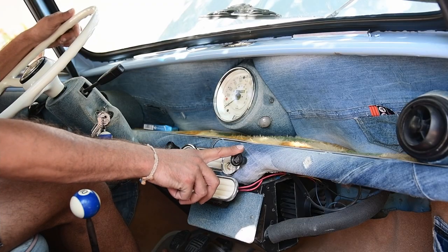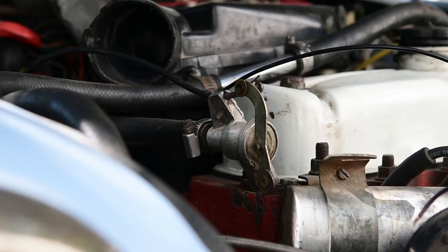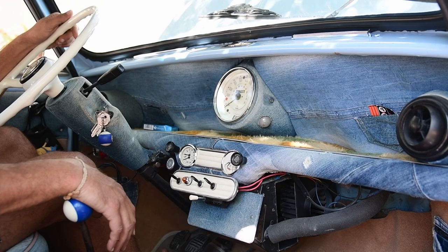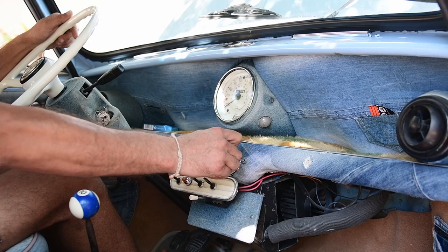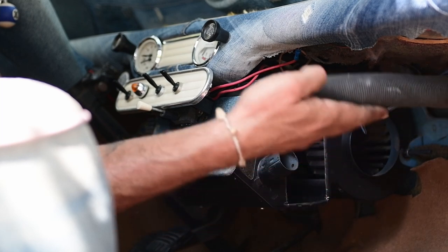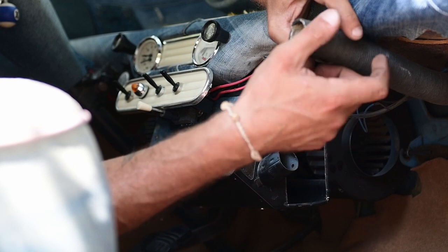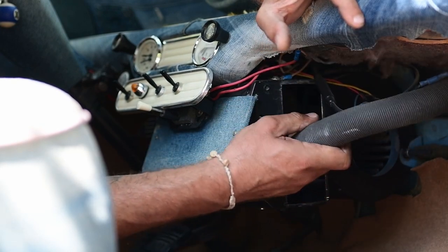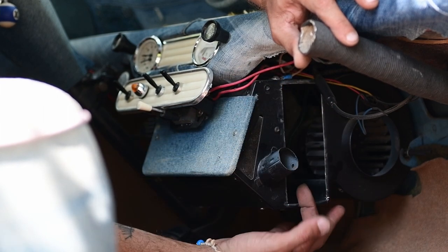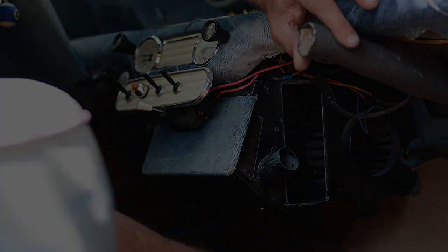By hooking the system up to the on-off switch for the heater, I can actually control how much cooling I get, when and how. When things get hot, I switch the system on. When things cool down again, I switch it off. The auxiliary radiator is actually the heating element from my cabin heater. I modified the box so I can slide the auxiliary radiator in and out without removing the entire unit, which also took away the concern of carrying one extra part every time I switch from a summer to a winter setup.